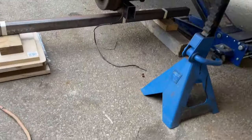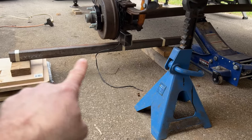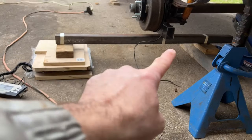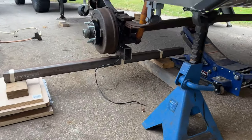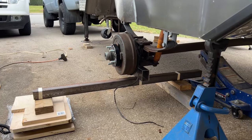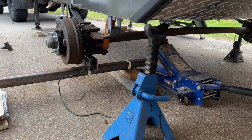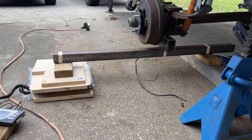Here's the setup for measuring the side weights. On the steel tubing I've got three marks — two feet from the weight to the scale and then one foot further, so whatever this weighs I multiply by three to get the actual weight, because it's a fulcrum system. I've got a jack stand underneath just in case, and the hitch connected to the truck. I'm going as close to the springs as I can because I want the weight at that point. No water in the tanks for this first test.